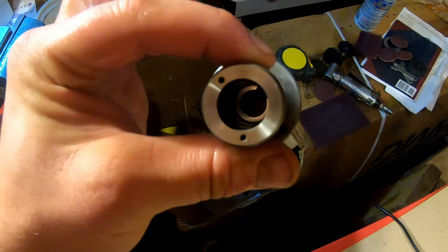This O-ring goes in that groove. That is an easy one. Pop that in by hand. Make sure it's seated. Don't roll these. Nice. Then this one, also pretty easy. This one goes in this groove. Little oil. These ones inevitably roll a teeny bit, but try not to do it too bad. Make sure it reforms its shape there.